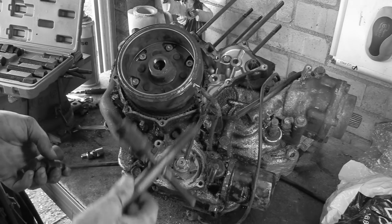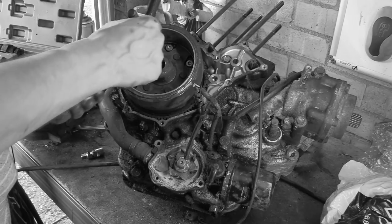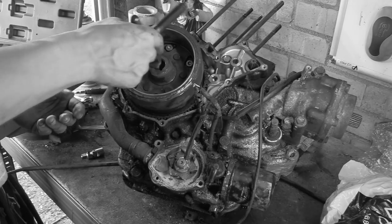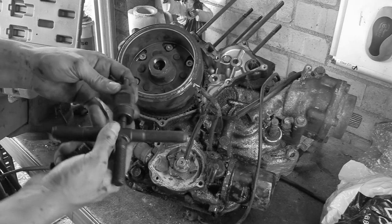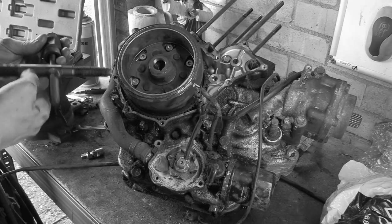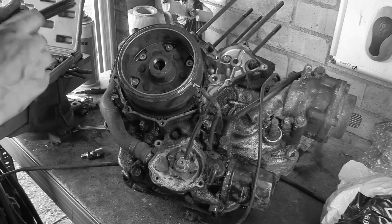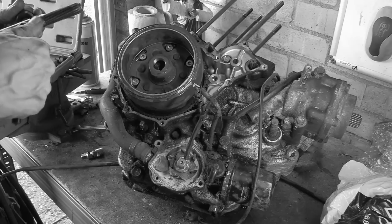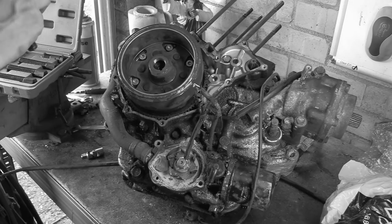Yeah, and then I've got one of these, which a lot of people have. That's got everything on it. And what it doesn't have is a 22 coarse pitch. That's a 22, but it's not a coarse pitch, that's a fine pitch. However, are one of these long enough? And is that a left-handed thread? You've got to be kidding me.